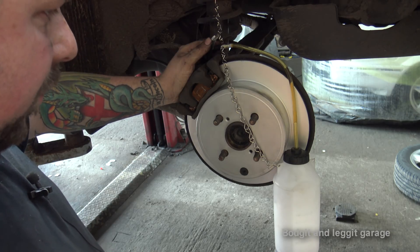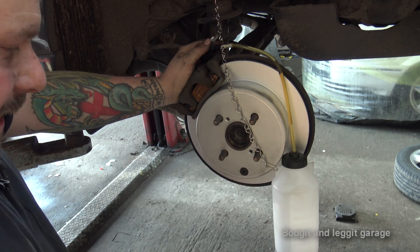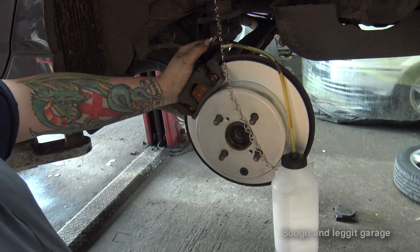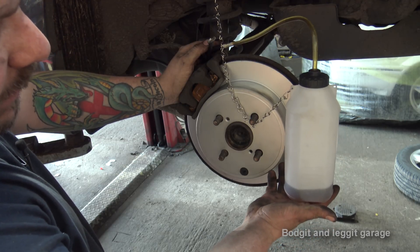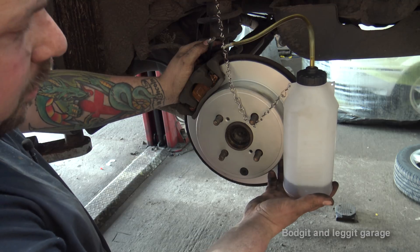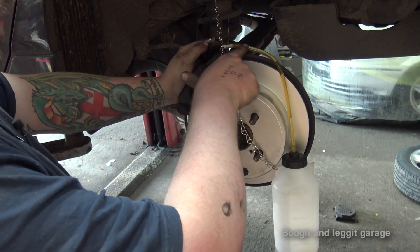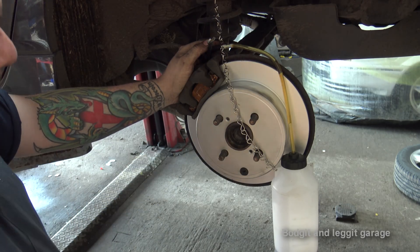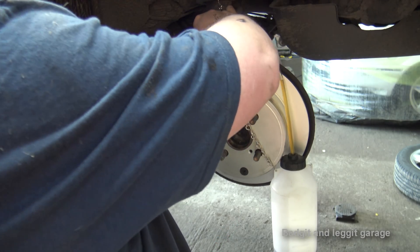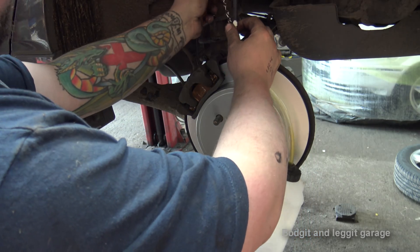You can see once this side is done — you can see the color of the fluid. Unless you test your brake fluid and it looks good but tests bad, you'd know to keep going. We're nearly there now — about halfway. Once we're halfway I can go to the first mark on the back and know we've drained them both equally. That's about it — the fluid color is completely different to what it was. Now lock this off, lift that up, pour it in the reservoir, no mess at all. Put the little cap back on and move to the next wheel.